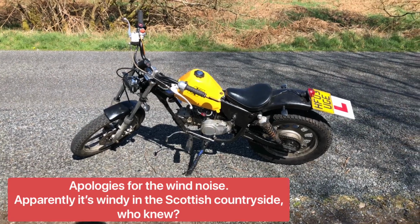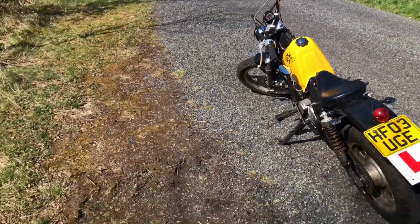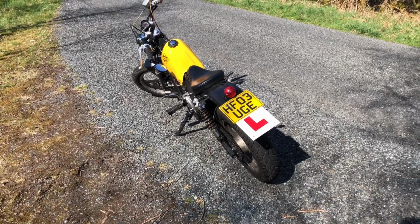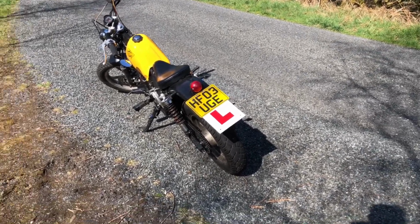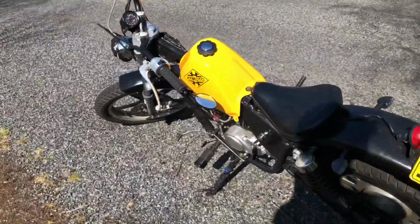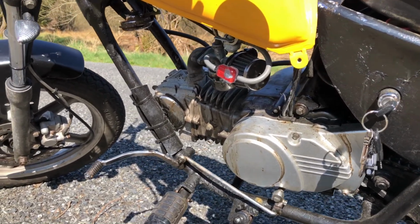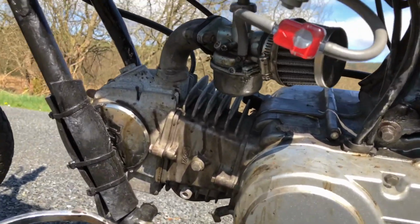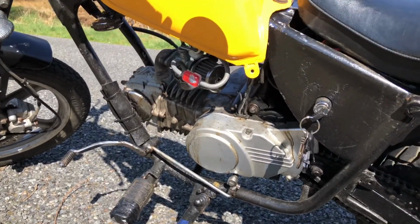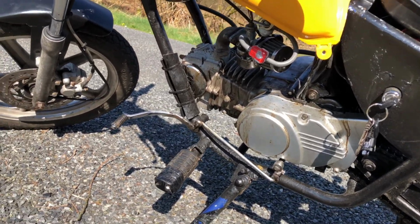Right, so I was riding along happily, and then all of a sudden the exhaust made a nice big pop, big old bang, and then it just stopped running. And I've also noticed, since it's sat here, that it's got a decent sized fuel leak from the carburetor still. So I need to replace that gasket, like ASAP. I thought it was okay, but apparently not.